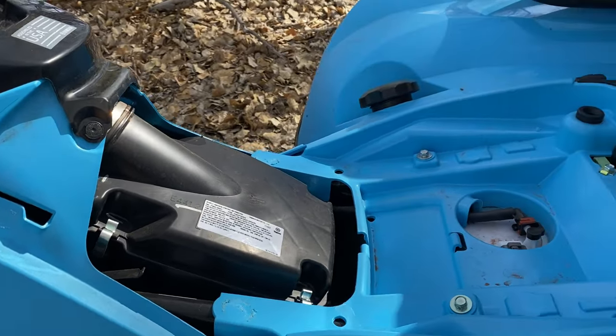All together, this is a nice solid build. I want to talk about air pressure. Yamaha had this filled to seven pounds in the rear and seven pounds in the front — that's too much. I dropped it down to five pounds in the rear and 4.5 pounds in the front. Reason being is rider comfort, and airing down actually has a useful impact on terrain — you're able to navigate rocks and mud just a bit easier. Definitely want to do that if you're into off-roading.